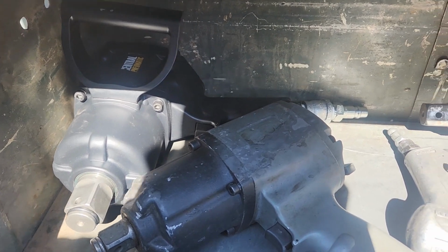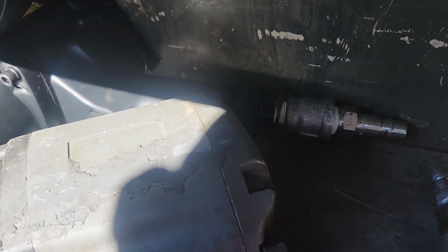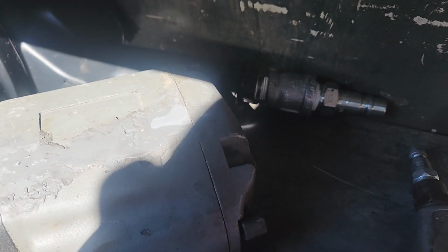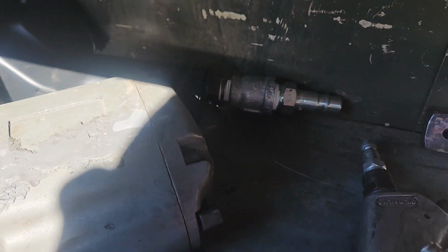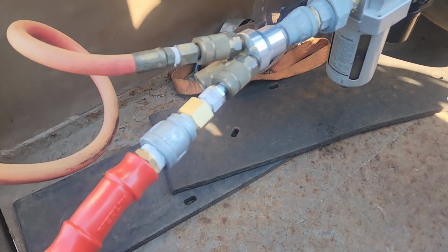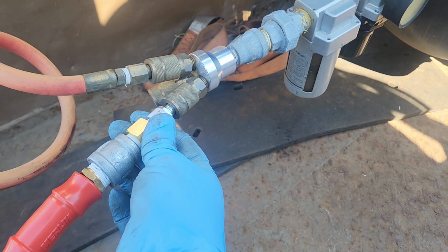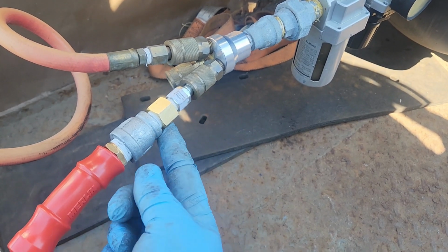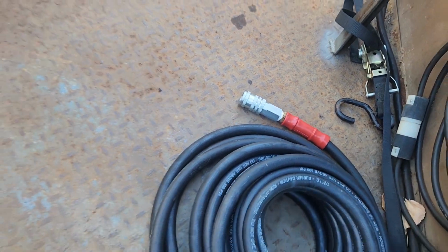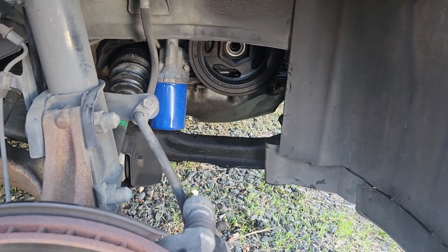So we got that half-inch hose, got some half-inch type G fittings. For whatever reason, this Harbor Freight one only has a 3/8 NPT inlet, so I had to expand that, for lack of a better term, up to a half-inch type G fitting. And then I reduced it on the other end of the hose to my deal here that goes straight into a quarter MPT, well, quarter MPT to 3/8 MPT to half-inch MPT, and then the regular half-inch type G on the other end of the hose. But with that I managed to get it within the first few ugga-duggas, and it's out now, so we're gonna carry on.